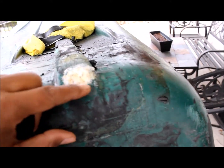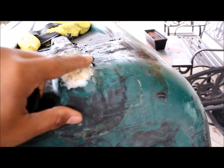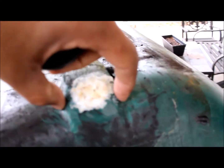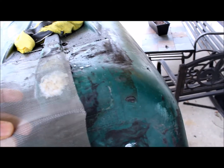So that's the plastic weld job — that's the first plug weld we did. We're going to let this dry, clean it up a little bit, kind of sweep these edges. We'll put this wire mesh on and I'll show you what that is. With that plug weld there, we're going to take this mesh and cut it to fit — just enough to go over about an inch on both front and back.